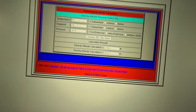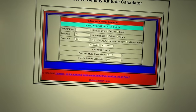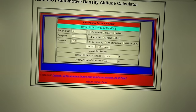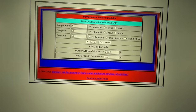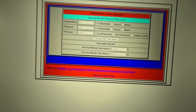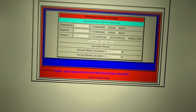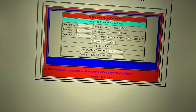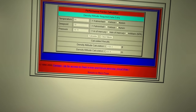You might say, well what is 2150? Basically it's telling you that your car at sea level will be operating as though it was 2150 feet above sea level. Now let's say your altitude is not at sea level — say you're a thousand feet above sea level. Your car is then not operating at 2150 but 3150 feet above sea level. People living at three or four thousand feet altitude are already at about four thousand feet effective altitude, which is going to impair horsepower.